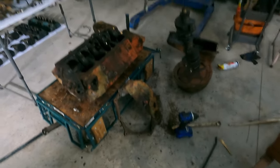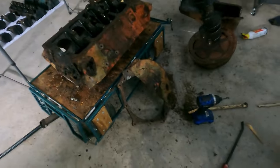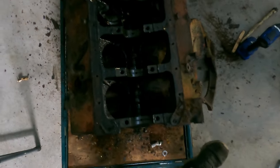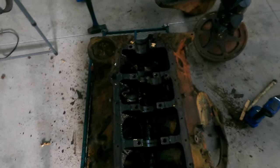All right, another hour later, crankshaft's out, got the collar off. Now I can get to the bolts along the flywheel here, or the flex plate. There's one, two, three bolts, and if that had spun, I could have gotten to them through that access hole, but since the stuff wouldn't rotate, we couldn't. Now, I have four cylinders out. The back four are stuck. So we're gonna soak them down, and I'm gonna go inside and eat lunch and put ice on my back.